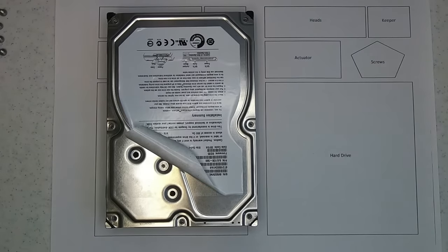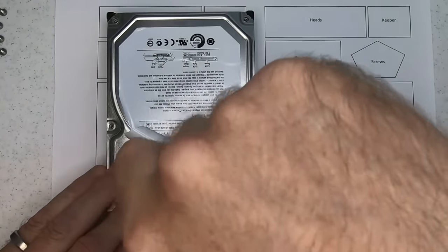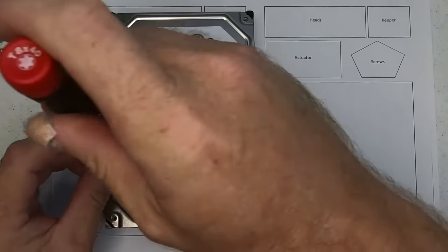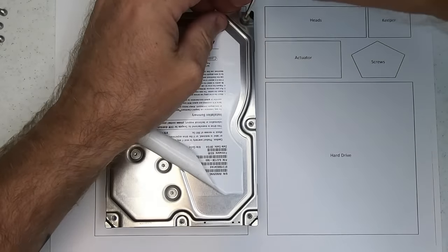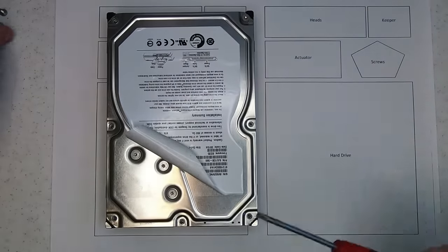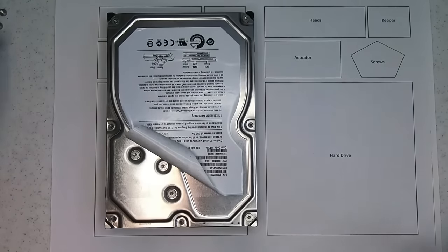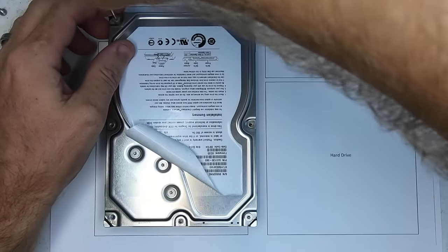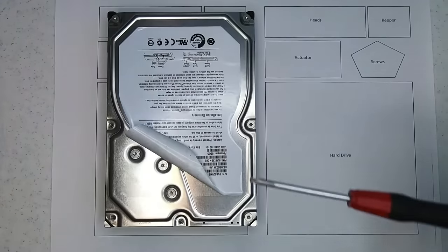So this is a two-part process as well. Assembling or disassembling the drive and putting the drive back together so that it's able to function is just one part of the process. Definitely not advisable to go plug this into Windows on a USB caddy or anything like that, because this is a drive that's in a degraded state. Anything's possible. There's a mystery behind it. You don't really want to put this into a Windows environment that is going to cause read retries, etc.